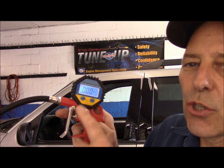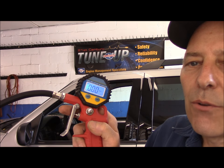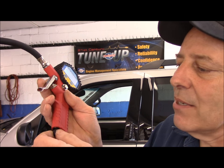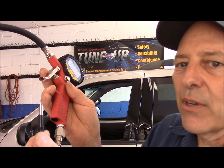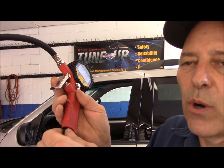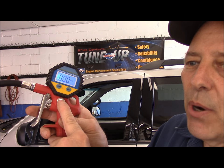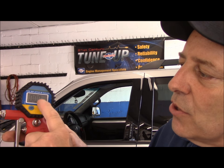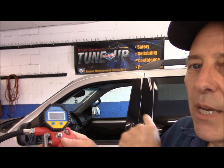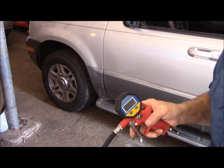What I like about this gauge is it turns itself off automatically after about 15 to 30 seconds. Down in the bottom it's got a valve extractor built right in, just in case you need to remove the valve. Also, if you need to purge air, you press this button and release until you get to your correct recommended pressure. So first thing we're going to do is go down to each tire and check them one by one.